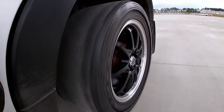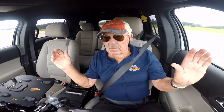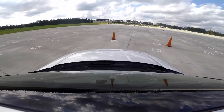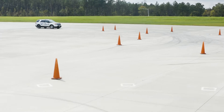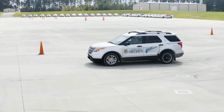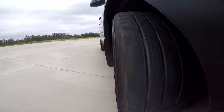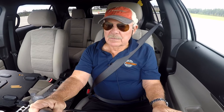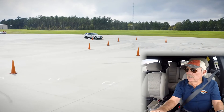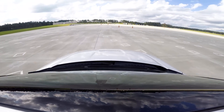So we're going to run Electronic Stability Control with the DTS on the back. We turn in, the rear slides, but you can literally let go of everything and the vehicle stays on the road. Electronic Stability Control tries to keep us on the pavement, but at some point you could actually need to help it too. What that means is the system doesn't know how much steering to input in the skid. So in this case, we're going to run down in here, turn in, when the rear slides ESC slows things down, but we're going to add steering to stay on the road and the car stays nice and straight. We stay in our lane and live to tell about it.